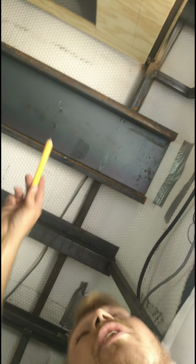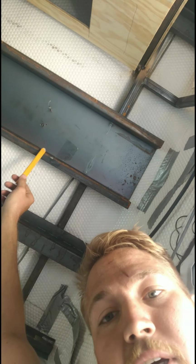There you go. Now what I'm going to do is drill a hole in all 4 corners inside, and then put my jigsaw through the holes and connect all the holes, and then trim it up as needed. The only issue with my process today is that I have a frame that is welded into the inside of the van. So this channel here, which is where the AC ducting used to be, and probably this square tubing, are going to have to be cut out.